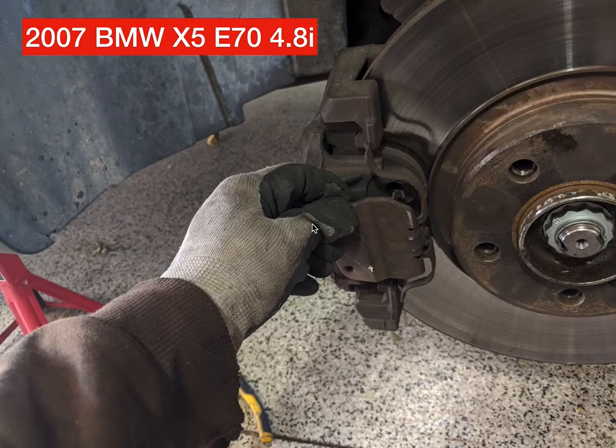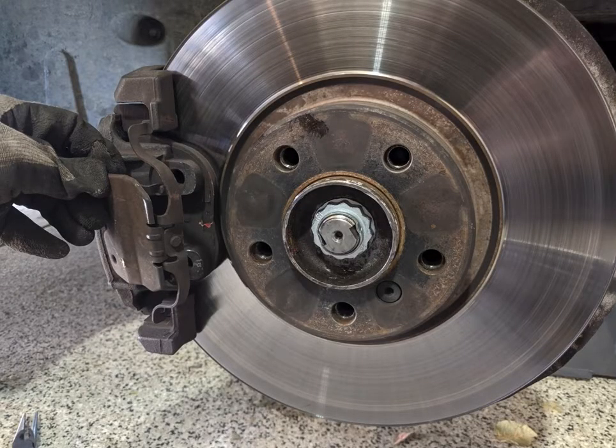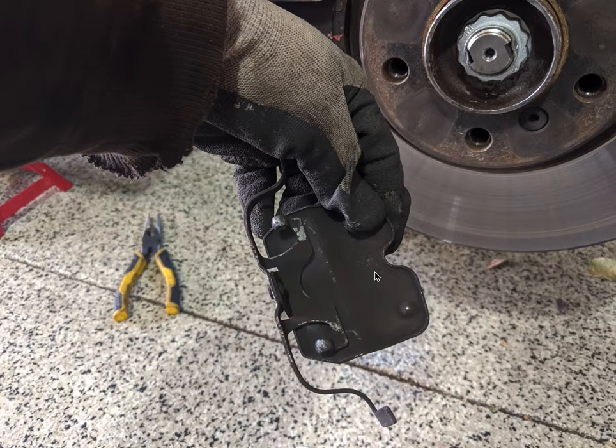It's just held in place by tension, and so to get it out, you insert a screwdriver on the front of it — which is the part closest to the center of the hub — and then just pry it up and kind of back out from the hub. You can see the little red mark on the back of the brake pad; that's where my screwdriver was inserted. I braced it against the hub itself and then pried up and back. You can see it just has two guiding pins, and then you bend the little tensioner springs and drop it back in — that's what holds it in place.